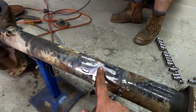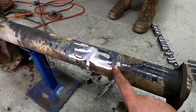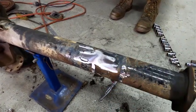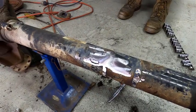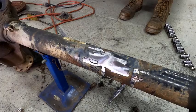So yeah, sometimes you can't do it. A flappy wheel won't get that finish. And you won't always get that straight away. Like Zach's gone through and ground a lot of this off, and then we've hit it with that sanding pad. If that was a stainless handrail and you went across it instead of with it, it'd be extremely hard to polish and get a nice finish on.